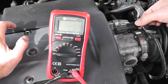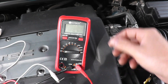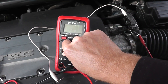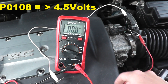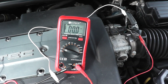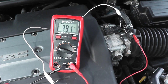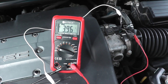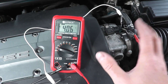I have my paper clips inserted and alligator clips attached to the multimeter leads — one on the left, one on the right. Make sure it's set to volts DC. P107 typically reads under 0.4 or 0.3 volts, and P108 is 4.4 to 4.5 volts and above. If you see either of those ranges, you know the sensor is no good. After starting the vehicle, we're at roughly 4 volts, so this sensor is working perfectly fine. That's how you can quickly test the sensor and verify you have a problem — especially useful when you have multiple engine codes and need to determine which component is actually faulty.